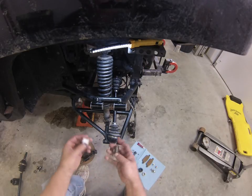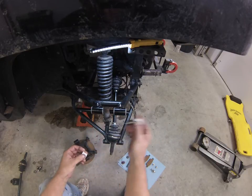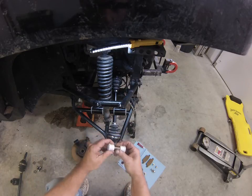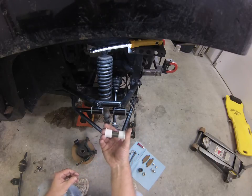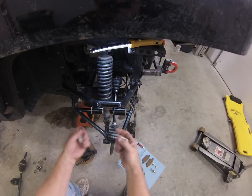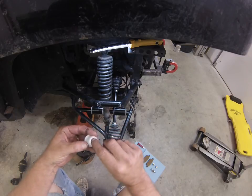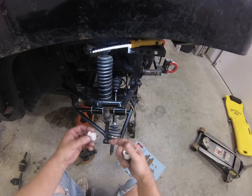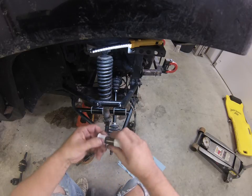Regular maintenance on the suspension: the whole suspension system mounts to a couple of A-arms, upper and lower, and where your caliper assembly and wheel bearing assembly mount is all put together with steel collars and Teflon bushings that fit together like so. I've already taken these all apart and cleaned them. You'll find, it might be hard to see, inside here there are 3 little slits that let the grease push out as you grease this through the greaser, and make sure your collar is greased and able to pivot like that.